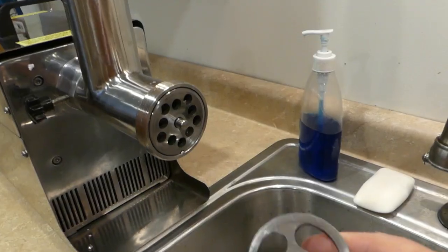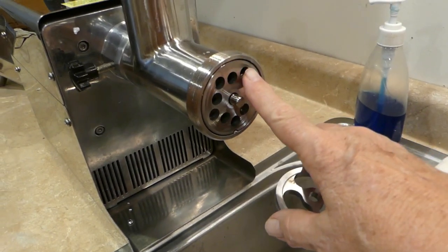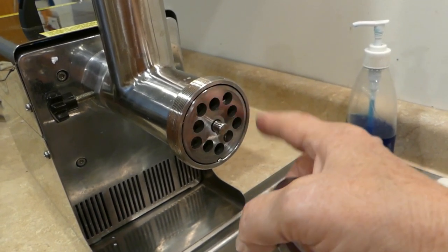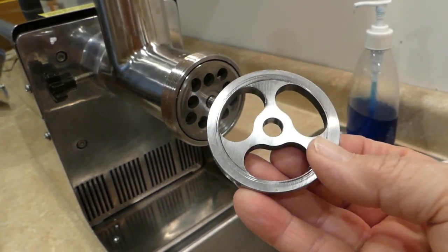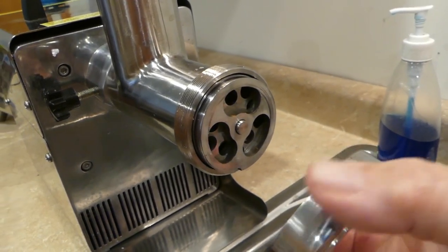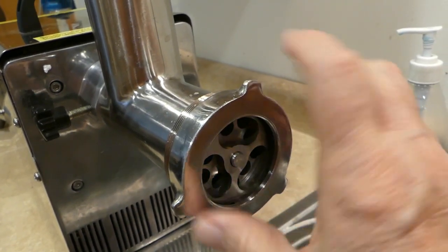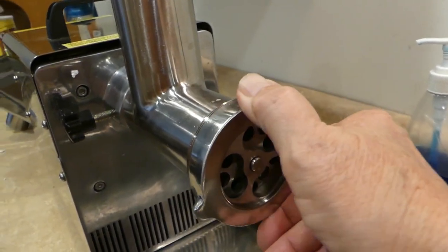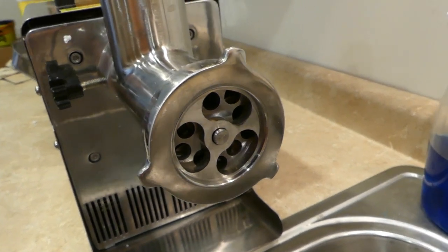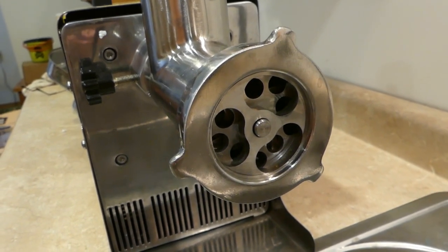Here's something I want to share that is a little bit unfortunate: I have had trouble with this single blade not going back far enough and staying up against the knife behind it. So I have taken to putting a second blade in the bigger blade and then putting this nut on that holds it in place, and it holds that first disc on much better and tighter. I don't have as much trouble with it stopping up, especially with the sinew. That's what tends to stop it up — sinew — and deer is quite sinewy.